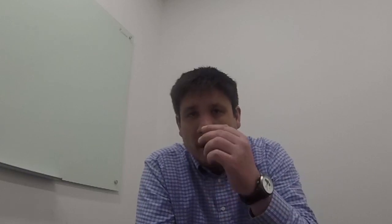Alright, so low TPS — definitely, if you're in boost, you don't want the PID settings working against you and saying, let's pull fuel and see if you can get detonation. Definitely don't want that to happen. And then the EGO delay start after is essentially for the wideband controller — so every time you start your car, you'll notice it heats up for a second on your O2 sensor and then finally says, hey, we're at temperature, let's give you some real values. But until then you can get some really strange values, sometimes all over the place, depending on the wideband O2 sensor you're using. Some of them won't give you anything close to a usable value until warmed up, and a lot of times that's after about five seconds.